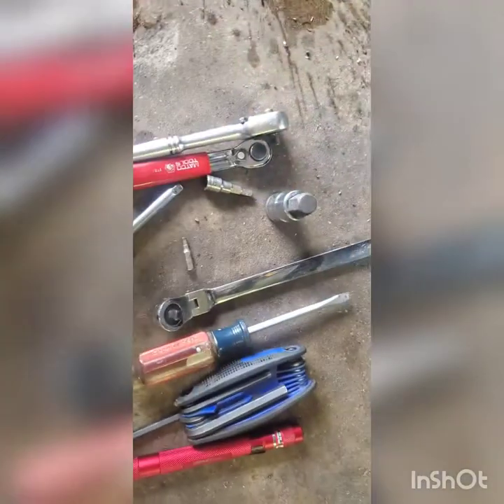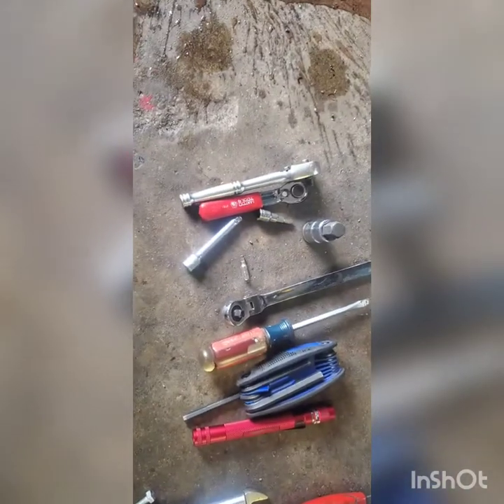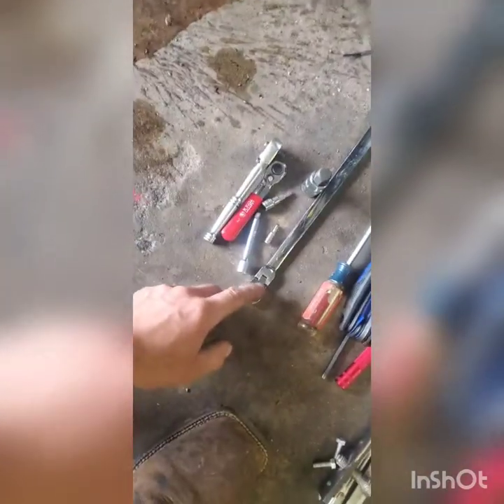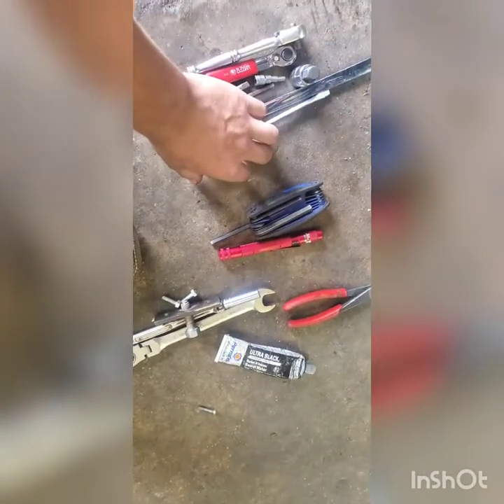You got your 14 millimeter for the drain plug if you choose to drain the oil. This bike's got 8,700 miles, so I figure I'm just doing the 9,000 mile oil change while I'm here. I already did the spark plugs and had it all torn down. I didn't have a manual when I tore it down but I accessed one to get all the torque specs when I put everything back together. You also need an eight millimeter, a six millimeter for your shifter and secondary drain plug with the magnet on it, a flathead to access your coolant lines, and another Allen wrench set.